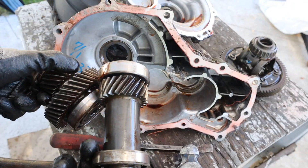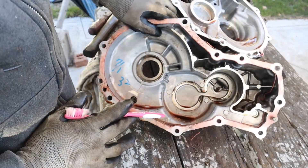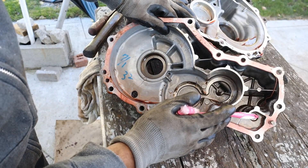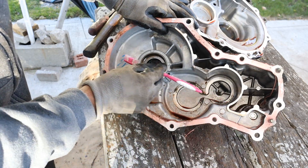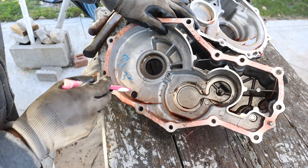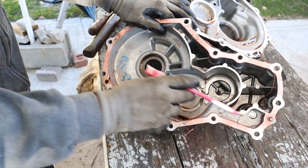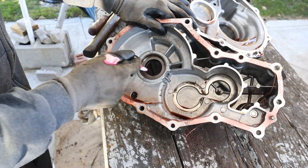This one's also a little grummy. Very small and simple counter gears. This thing has transmission fluid inside and does not have gear oil. When you're doing your transmission fluid service, this would be your fill plug, and that would line off with the transmission seal on the output. This would be your drain plug at the bottom. You always want to have fluid about this line here — you never want to overfill it because it can just leak out the seals.